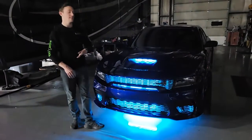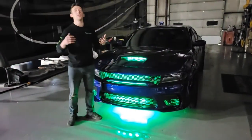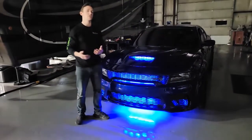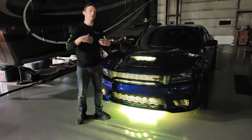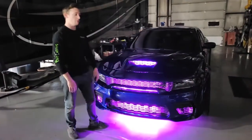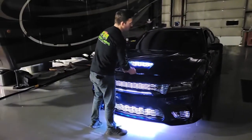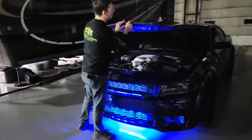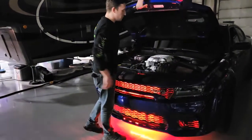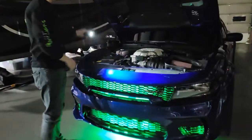The key when you're putting strips on any of these grills is to go ahead and completely remove that front grill. That way you'll have fewer obstructions and you'll be able to place those strips nice and easily, as opposed to trying to fish your hand in there and find placements for them. We're going to walk you through how we remove this front bumper — on all these grills it's going to be a little bit different, but for the Hellcat you're going to see a lot of the same pins and placements.